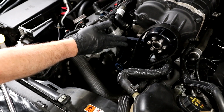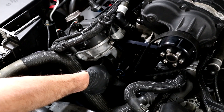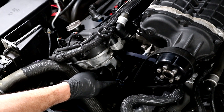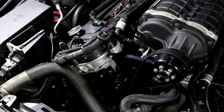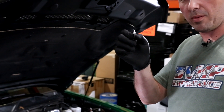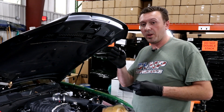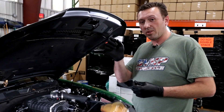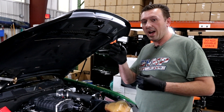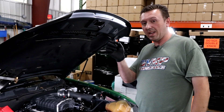I've gone ahead and gotten the Bomber Bracket installed. I've reinstalled the water pump pulley and the accessory belt. You can see that this idler is already torqued down. This idler is where the Roush Spider Bracket is going to tie in. I've gone ahead and routed my belt — I'm going to pop it in there. This little stepped washer goes between the Roush Spider Bracket and the upper idler on the VMP Bomber Bracket. If you're using the 61-millimeter idlers with the thinner 12-millimeter bearing, the washer is going to go this way with the small side out. If you're using one of the heavier-duty idlers like that included with the 8-rib kit, which has a 14-millimeter wide bearing, you're going to flip this spacer around and the step is going to go in.